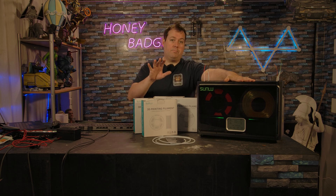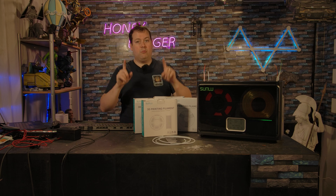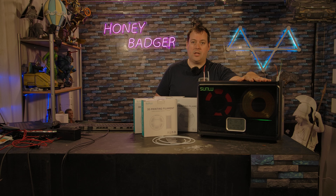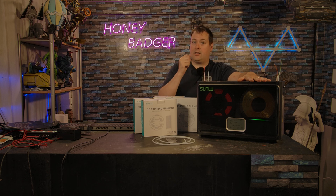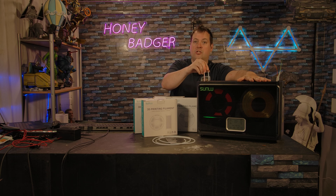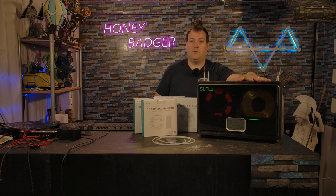An important point: this is not an AMS, and this is not a multi-material system, in the sense that none of these spools are motorised. They are all just on runners. So when you pull filament out or push it back, the spool is not pulling it back like it would in an AMS. The spool is simply sitting in there. So it will be fine with your retractions, but just be aware that if you shove a bunch of filament back down the PTFE tube, you're going to end up unspooling part of your spool and you could end up with filament tangles.